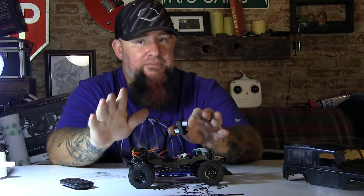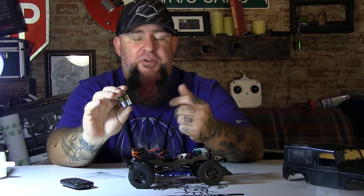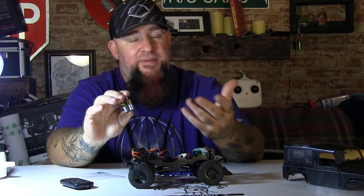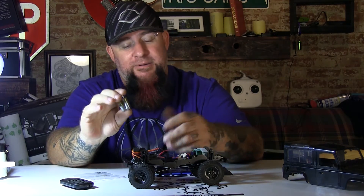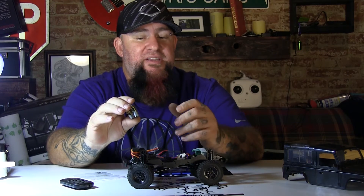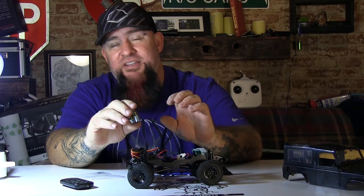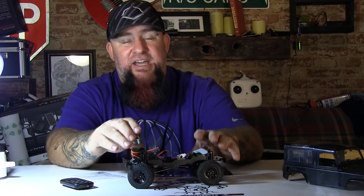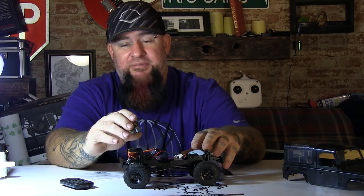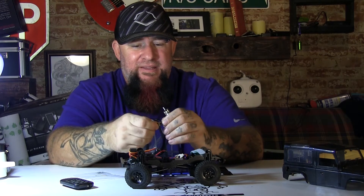Price wise I'm not going to quote a price because it may vary from when this video airs, but it was cheap for what it was. The motors — I got two motors for $9 shipped from a US seller. You can order from overseas for as cheap as $2-$3 each shipped if you don't mind waiting six weeks. I'll probably order more to keep as spares. I would assume these motors will last a pretty good while since they're reduced and I'm not running the full voltage they can handle. The videos I've seen of them running look very impressive, so I probably would have done this mod regardless — individual power going to each axle is a win-win. Run time I don't know, but with the gear reduction it may not use as much current.